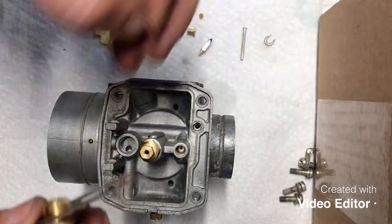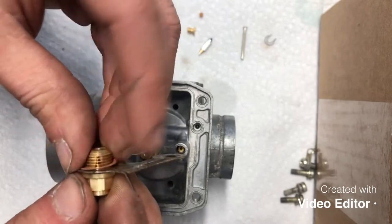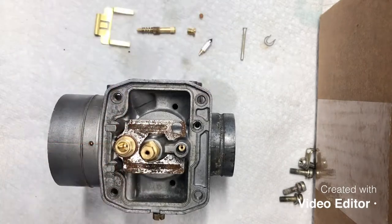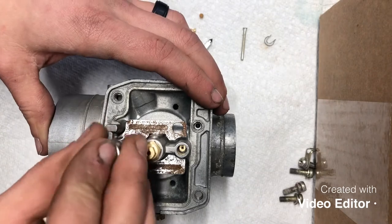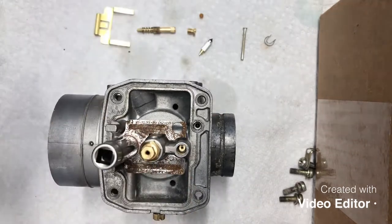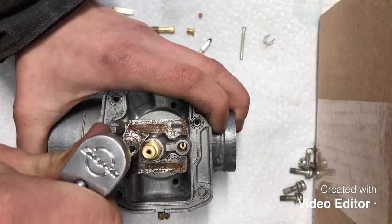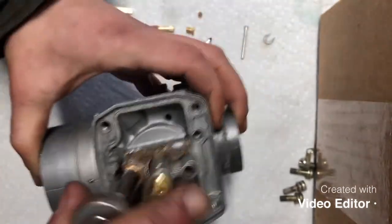And then your second sealing washer goes like that, and then all that threads right down onto here in between the towers, and that gets tightened down with a 9 millimeter. Hand threading it in first and then snugging it down. So it'll look like that when it's done.